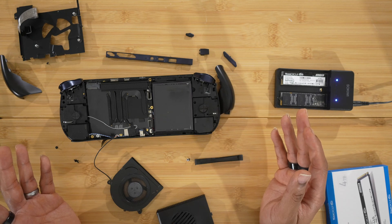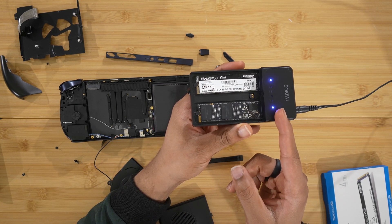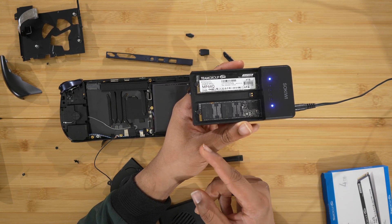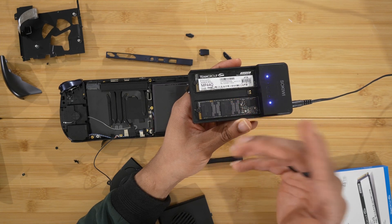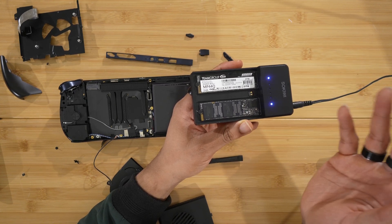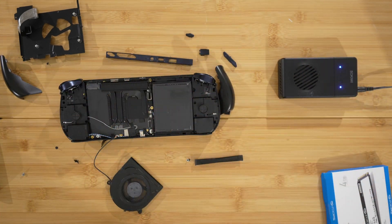Sue me, it's Christmas — but the next step is to clone the SSD. Some people like to use a software cloner, but I swear by this hardware SSD clone tool. I've been using it for a lot of my devices and I'm always cloning these things. You put the target SSD in here and the source SSD, and it's going to make a perfect clone. The remaining space will be an unallocated partition on the drive that you can expand however you like. I'm going to let this run its course — I don't have much data so it may take about 20 to 30 minutes.